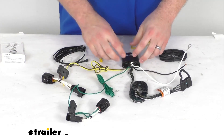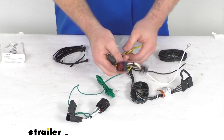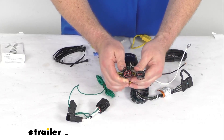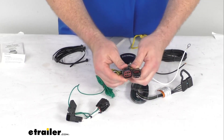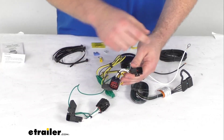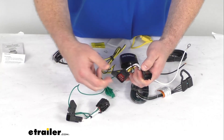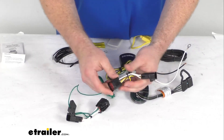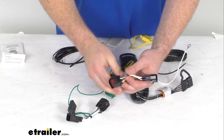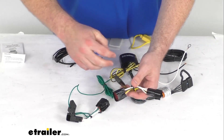This system is going to install back by your vehicle's tail lights. Your yellow wire here is going to be your driver's side. You can see we've got these plugs — these are where it is custom fit for your vehicle. You'll see plugs that look very similar to this after you get access back to your tail lights. You'll unplug that connection that is currently there and then plug this in-line, re-completing that circuit so your vehicle's tail lights function normally even when you're not towing, but also sending that signal out to your trailer so your trailer's tail lights reflect what your vehicle's lights are doing.